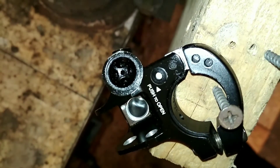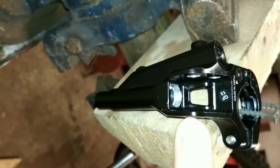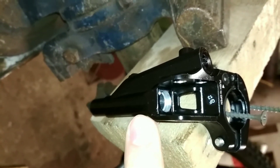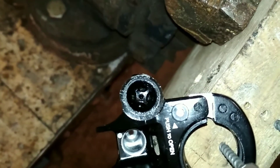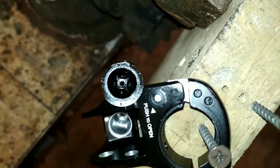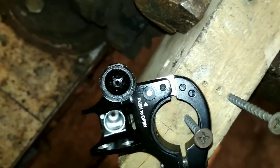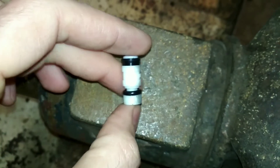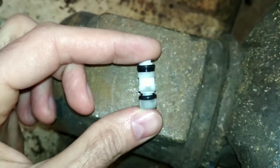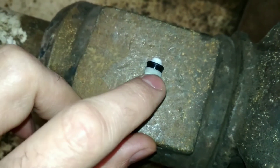That's the bottom of the lever — the scuffs are on the bottom and more towards the front, around this area. The dust rests on the bottom and that's where it will get through quickest. I found out straight away when I pulled out the piston — look how scuffed it is. The piston itself is perfectly clean on one side, and the gray area is the scuffing.